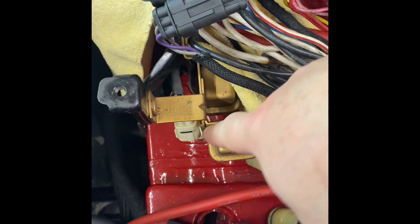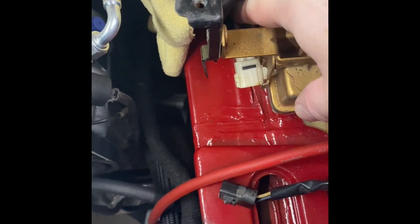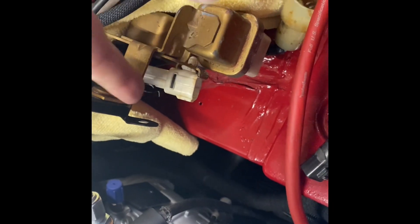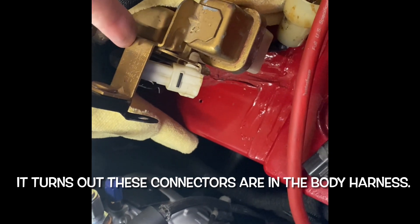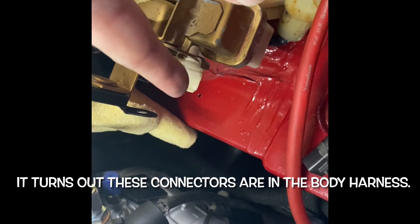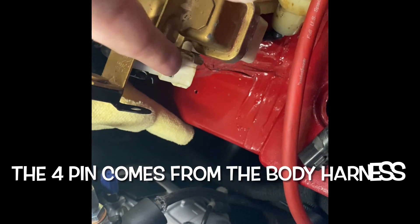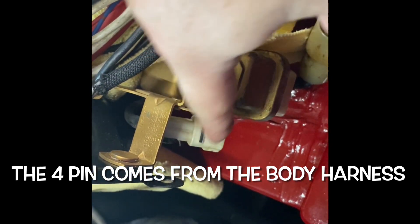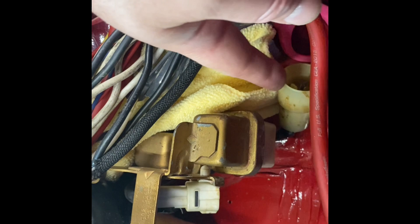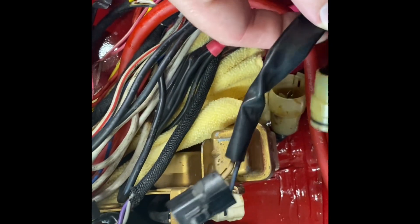One of the things that I'm missing — and I'm glad I found this now before I finish the motor harness — I basically have to feed this relay if I'm going to use it to turn on the condenser fan. This connector here, I have to get a connector for this. I'm just going to try to get the wires added in the harness. There are four wires that go to this. I know that this is actually the condenser fan, and we actually have that in this harness here to connect it once I get all this completed. That feeds the condenser fan there.